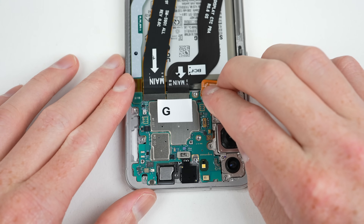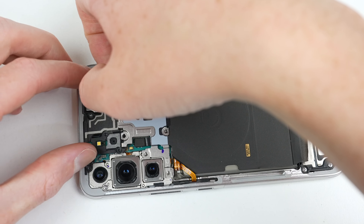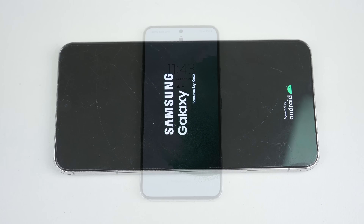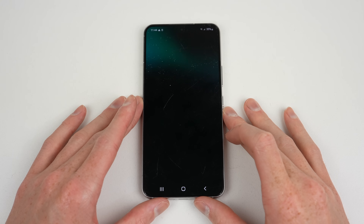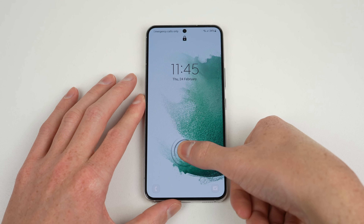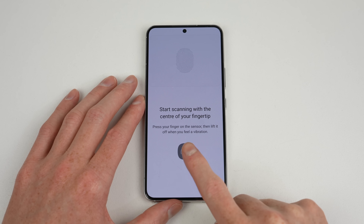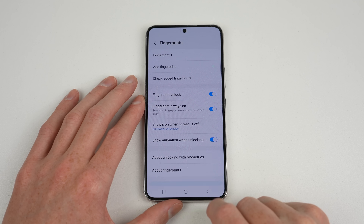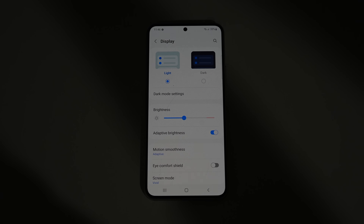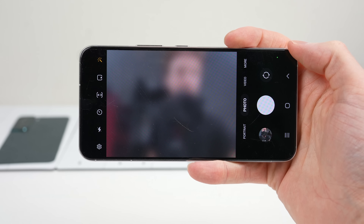With the green phone's motherboard in the silver frame, it's time to reattach everything. I won't install any screws just to save time, but the phone will work regardless. I'll flip the phone over and power it up. Upon boot, there's a warning notification — but it's just a message telling me there's no SIM card installed. Going through and testing all functions: the fingerprint still worked and was able to register fingerprints programmed both before and after swapping the display. Auto brightness and all diagnostic tests passed with flying colors. Additionally, all cameras work as expected in both photo and video modes.